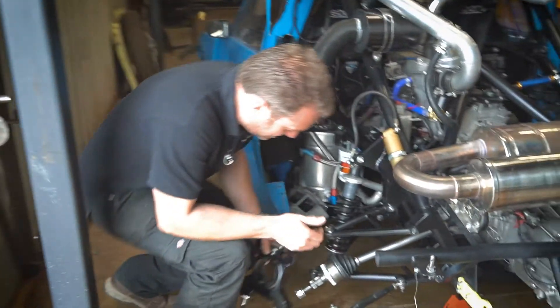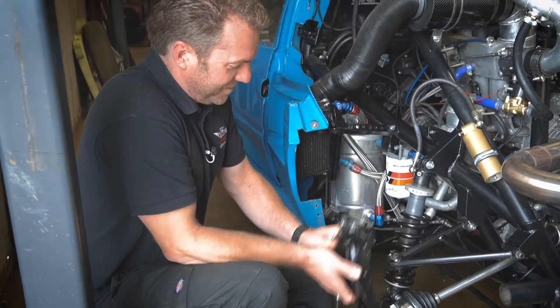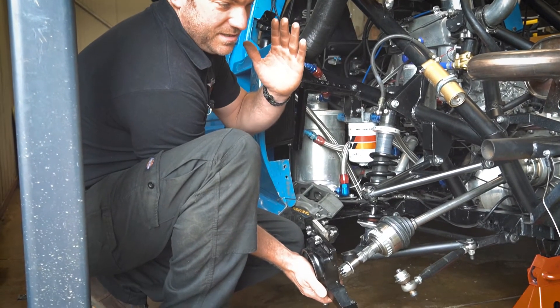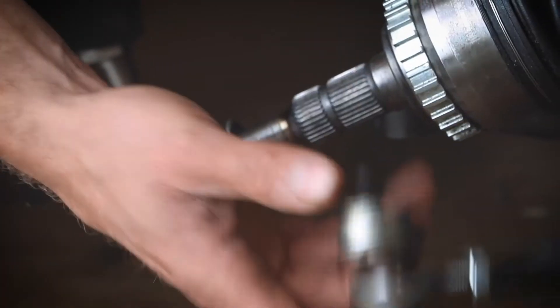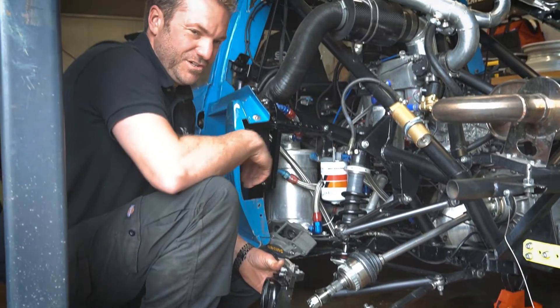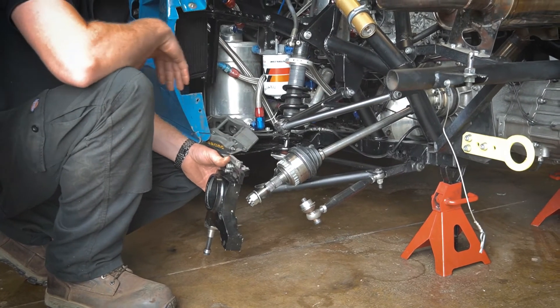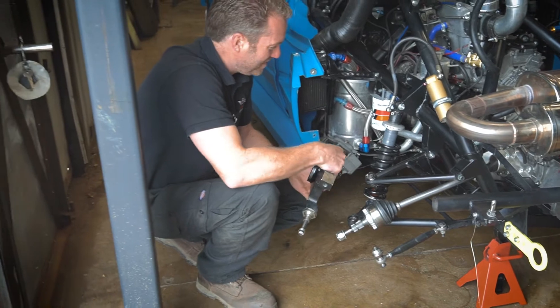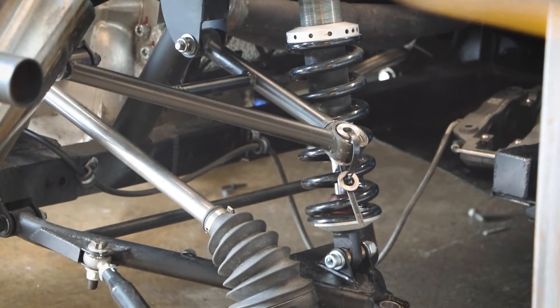This is one of the uprights off of the car — it sits here when fully assembled. Adjustments are as follows: you've got these spacers that adjust the top link in and out, which adjusts your camber. You can also adjust bump steer by putting spacers underneath this link — that's what these spacers are for, though measuring for bump steer is quite in-depth, so that might be another video. This link here adjusts your toe. So it's all very easy to do, very quick and simple. Adjusting bound and rebound is done by these two adjusters on the shock absorbers. It's a really, really good design, and we'll be proving it on track soon.